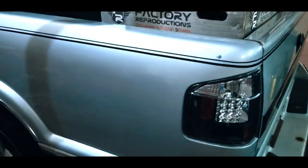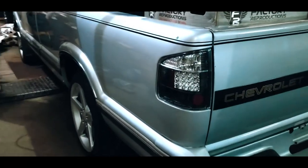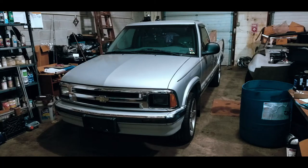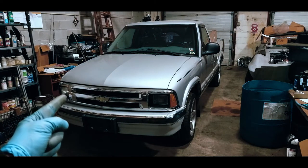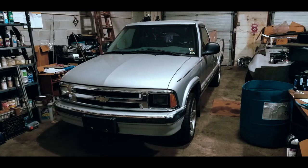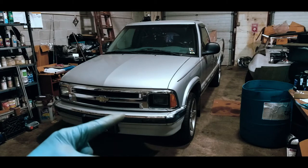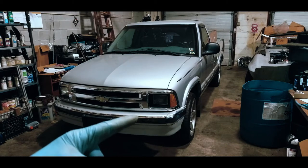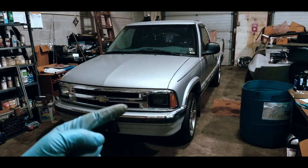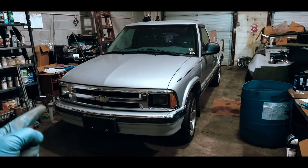There's a resistor box included. If that gives us problems I'll probably just delete it and run electronic flashers for the turn signals — that's what I did with the Camaro and it worked out pretty good. I'll leave links in the description. They work — not bad, not bad. I kind of like it, it's a nice little update. So we moved everything around and looking at these headlights — notice this one's real dark and that one looks normal. This one is extremely dim; I think water got in there or maybe the bulb's half burnt out.